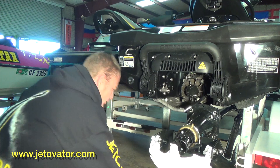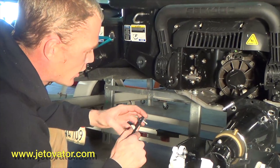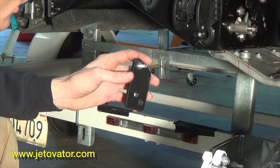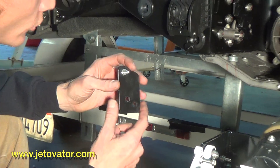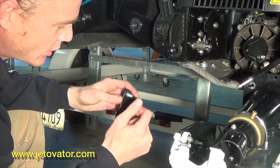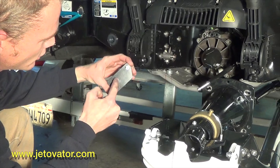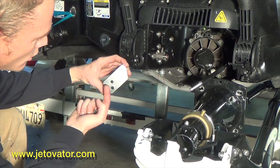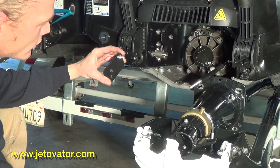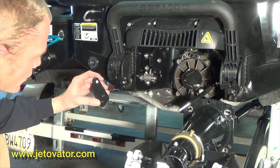Then you're going to take the bracket that we supply. We're going to give you two extra bolts that are a little longer, and we're going to give you a quarter-20 bolt — a one-inch quarter-20 — and you're going to want to run it through one end, come out the other end, put a nut on it, and tighten it down the best you can. When you assemble it, make sure that your two holes are going horizontal and this bolt is shooting forward towards the front of the ski. You don't want to have it reversed or you're going to run into binding issues with the bucket.